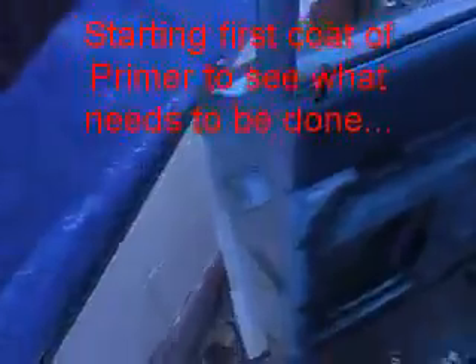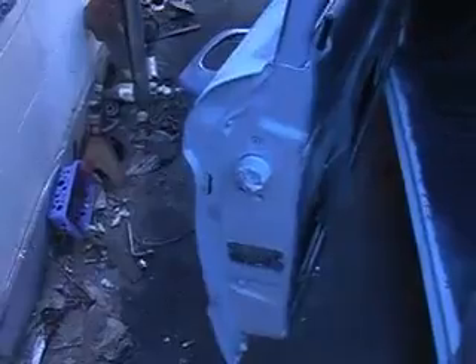I started on the paint here. I pulled out the interior stuff, went through and squirted the door jams. The top looks like I had a little hole I need to fix. This primer is non-sanding primer — I couldn't get it to harden so I mixed it up with acrylic enamel hardener, and that's hardening up now. Just getting some of the jams and things done.